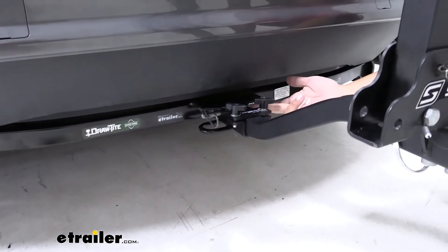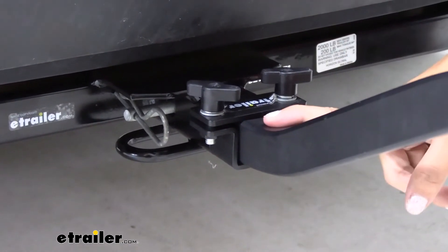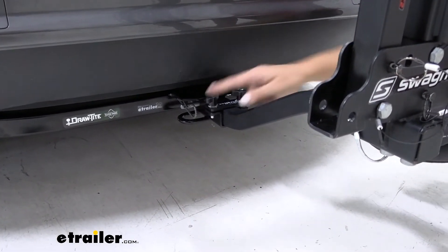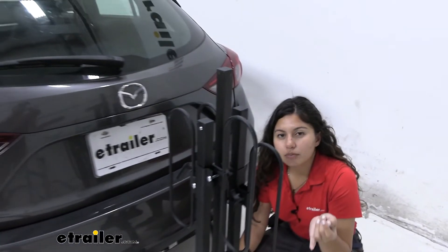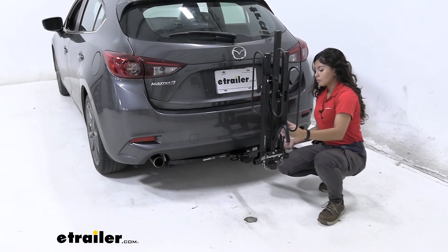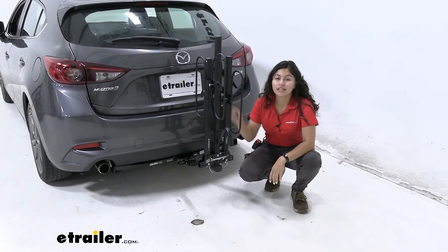Let's talk about how it fits into our hitch. We have an inch-and-a-quarter shank because our Mazda 3 has an inch-and-a-quarter hitch receiver — a Class 1 hitch — and that's okay because this bike rack is Class 1 compatible. I also have a hitch pin alignment collar here from etrailer; it doesn't come with the bike rack but it makes it much easier to pop the rack in without looking back and forth to line up. Then you just tighten down the anti-rattle bolt. I recommend using a ratchet wrench with a three-quarter socket. With the anti-rattle bolt tightened, the shank is secure to the bike rack and the rattle is taken out, making for a smoother ride for your bikes.